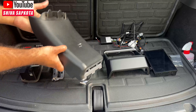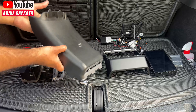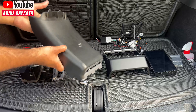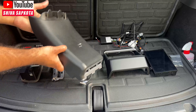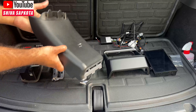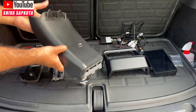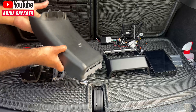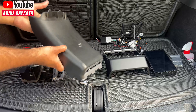The first step is removing the top unit — no pry tool needed, just use your fingers to pull it out. There are no screws; it just comes out like this. For newer cars with USB-C, there's a plate you just lift up and then pull out. If you have a USB-A unit, there's a little button you have to pinch in the middle while pulling it out.